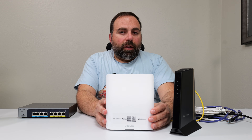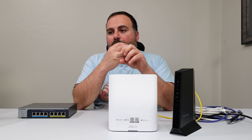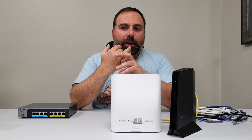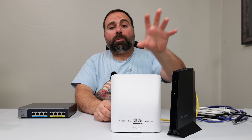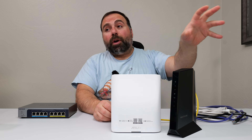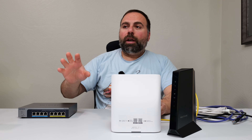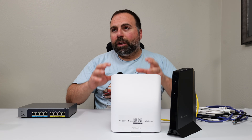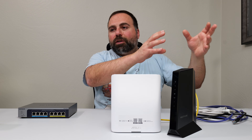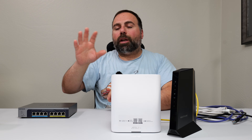At this point, it's a good idea to download the ASUS Router app, available on both iOS and Android. It walks you through setup, asking you to pick a Wi-Fi name and password. For this Wi-Fi 7 mesh system, I like to create a separate Wi-Fi 7 network SSID, then later make a normal one. My Wi-Fi 7 devices connect to the fast network, while everything else connects to the normal network, since not everything is compatible with Wi-Fi 7.